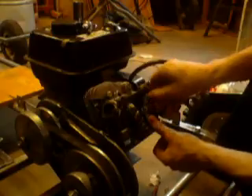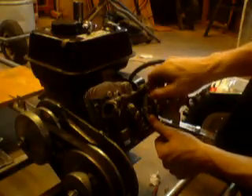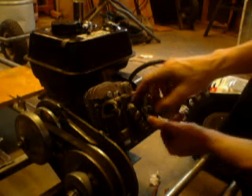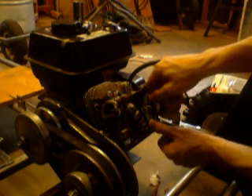Remove your nuts on the lashes you want to measure. There is a lash cap under these rockers — make sure it's on your exhaust side. I've made that mistake already.